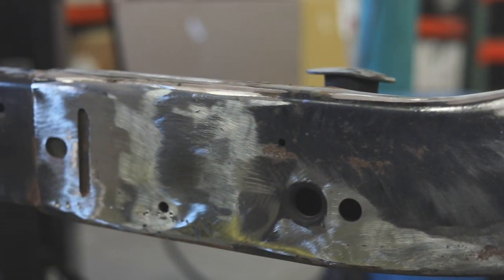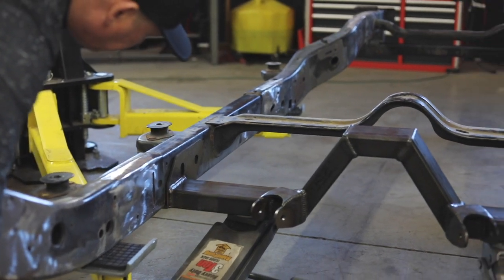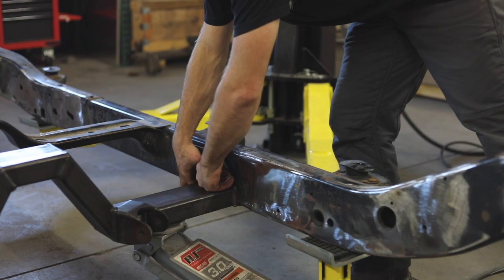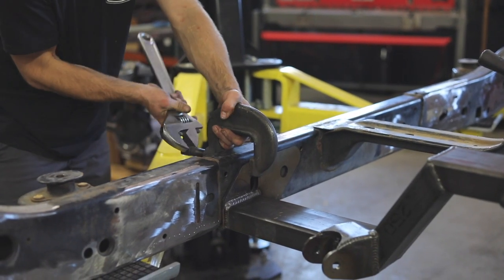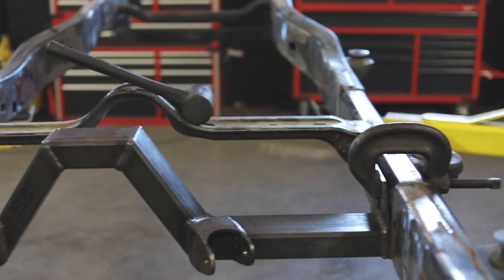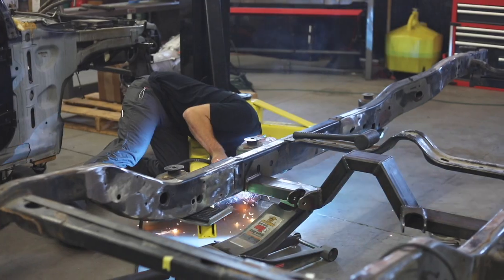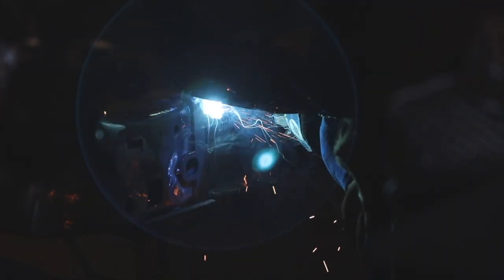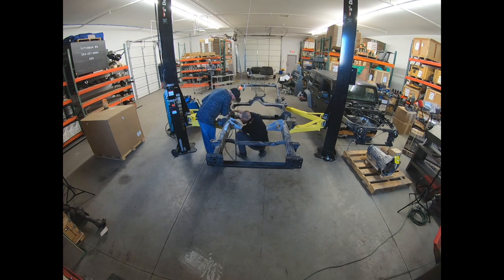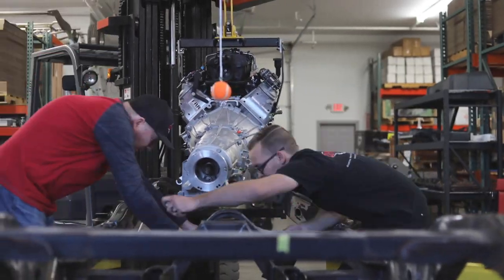The bracket install was rather straightforward using the Genrite suspension crossmember and the Overland Performance engine mounts. The brackets from these companies were designed to line up with various design spots on the frame, making the install easy. First up were the front and rear crossmembers for the 3 and 4 link suspension setups. One of the cool things in the design of the front 3 link crossmember is it serves as a tranny mount platform with no need for a separate crossmember, making for less clutter and a cleaner install.